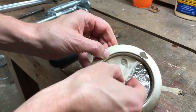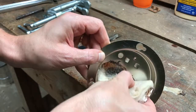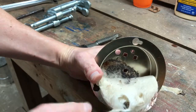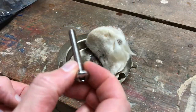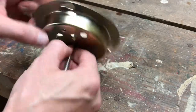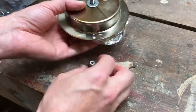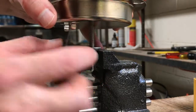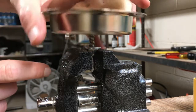Now I have to clean up the other side of the screw hole. The fiberglass is glued to the metal but not very well, so it can be pulled off very easily. Then I wipe off the metal shavings left by the drill. In addition to deburring the hole, I also have to remove the gunk around the hole so the bolt head lies flat. I insert the bolt, turn the plate around, and add a washer and lock nut. Lock nuts don't turn easily, and this one has to be moved almost two inches up on the bolt. I tried various tools, but in the end clamping the nut in a vise and using the electric driver worked the best.